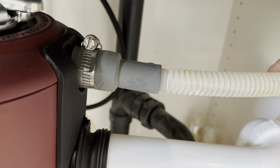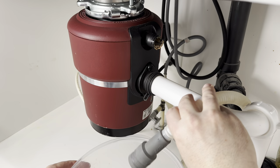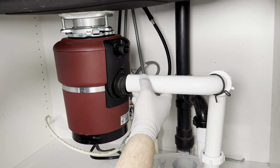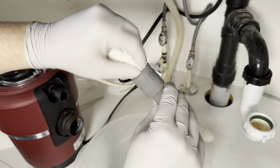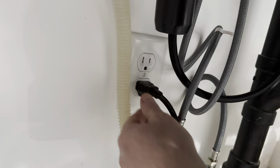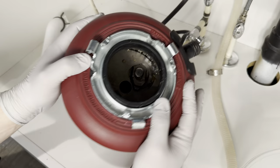To get that out I'm going to run a load on the dishwasher and turn on the disposal. After 30 seconds nothing drained so I need to take it apart and make sure nothing's blocking it. There's a lot of debris in the connection to the disposal so I'm also going to check the drain pipe to the main water line. There was nothing in the main drain so now I'm going to check inside the disposal and clean out the drainage hose. When I cleaned out the hose there was a lot of junk but there was nothing solid in there that would have prevented the hose from flushing out. So the next step is to check inside the disposal but first I'm going to unplug it because it'd be a pretty bad day if someone accidentally turned it on. When I looked inside the disposal the drainage line was definitely plugged up so I'm going to push through a paper towel to clean it out.